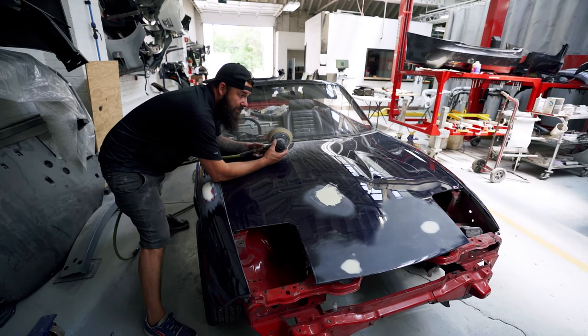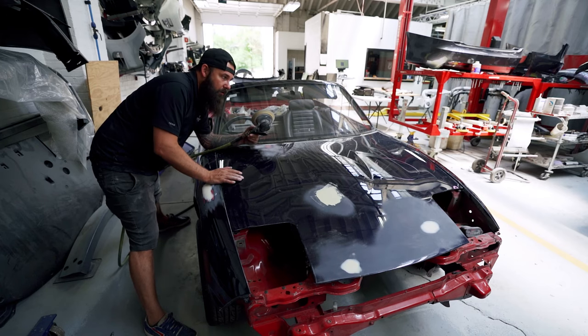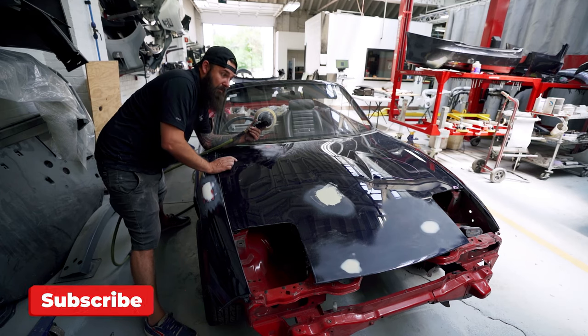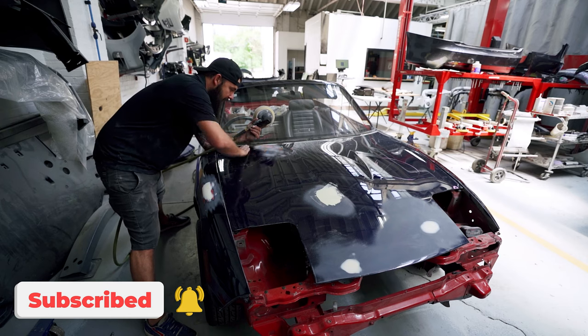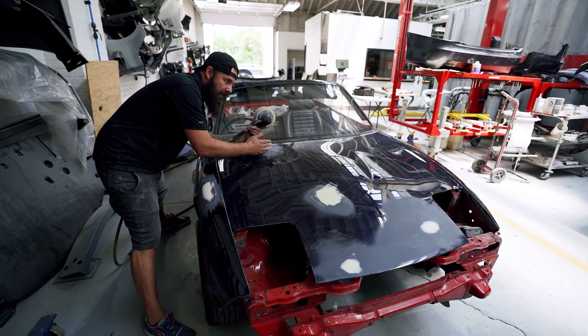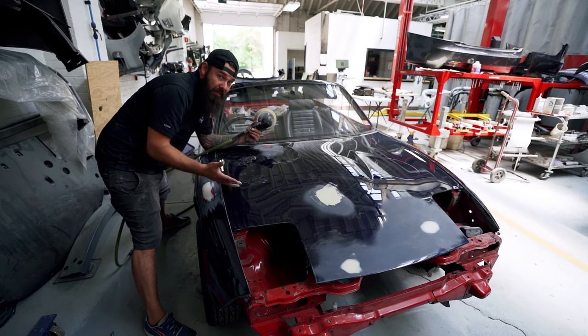That was Francisco — he is the one who's going to be painting the car. I asked him to come over and get his eye on it to make sure I'm not missing anything, and he found probably six or seven more dents that I couldn't see. So we're going to continue to sand all those down, skim coat them, re-sand them, make sure everything is nice and flat, and then we can scuff it and it's ready to paint.